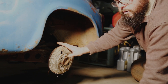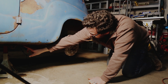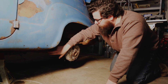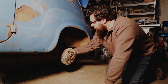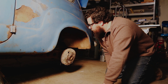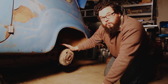To get this off, I've got a new flex line for the brakes — I'm going to cut that. There are two suspension bolts and some bushings in this trailing arm that I'm going to pull out. I'm going to pull the nut off the bottom of the shock and get the bolts that connect the axle to the hub. We'll get that done, get all this cleaned up, and come back when we're ready to put it on.